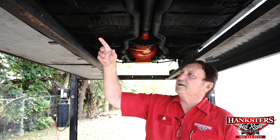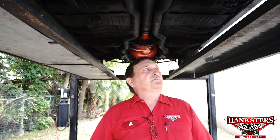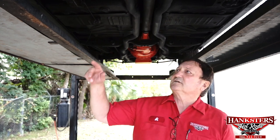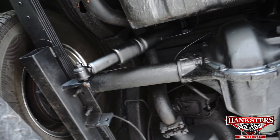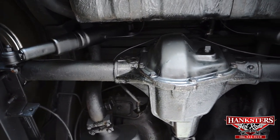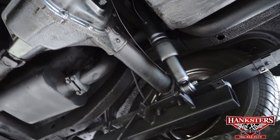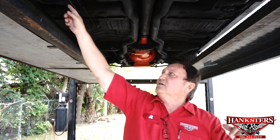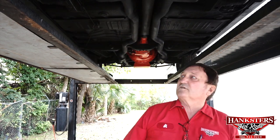Why, I have no idea. But they are there, maybe just for looks. They certainly don't provide any function. Chrysler's already addressed that issue with the suspension. They have 6 leafs on this side, 7 leafs on this side to compensate for torque bias. And as far as the traction bars go, there's already a pinion snubber and a plate on the floor pans to stop that, where these snubbers on the traction bars would do that normally for you. But it's already been addressed by Chrysler, so why those are there, they must be for decoration, I guess.